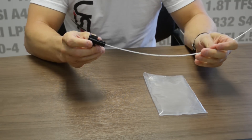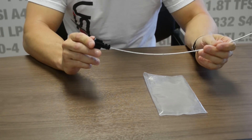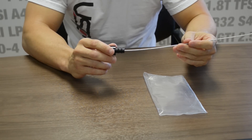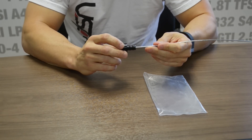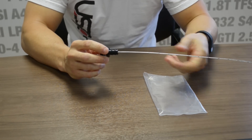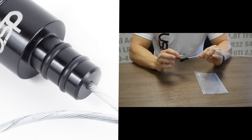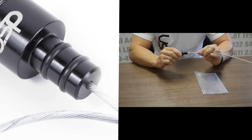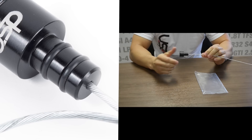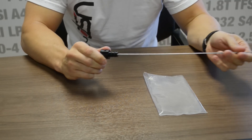Another cool feature is our O-ring system. Most oil dipsticks have one O-ring on them. The problem with that is any of you high-horsepower guys will know that after a long quarter-mile run, you'll come back and see that your oil dipstick has popped up. The reason for that is crankcase pressure. So we took note of that and decided to do multiple O-rings on each particular handle to make it secure. After you install this product, you'll notice it's kind of hard to pull up — and the reason we did that is purely so it doesn't pop up and blow oil over your engine bay.